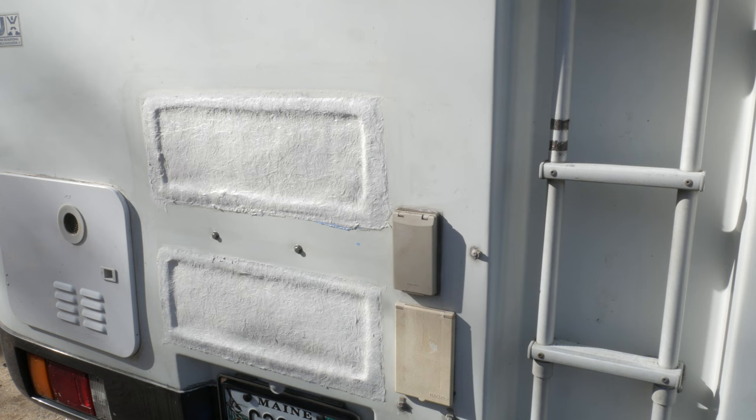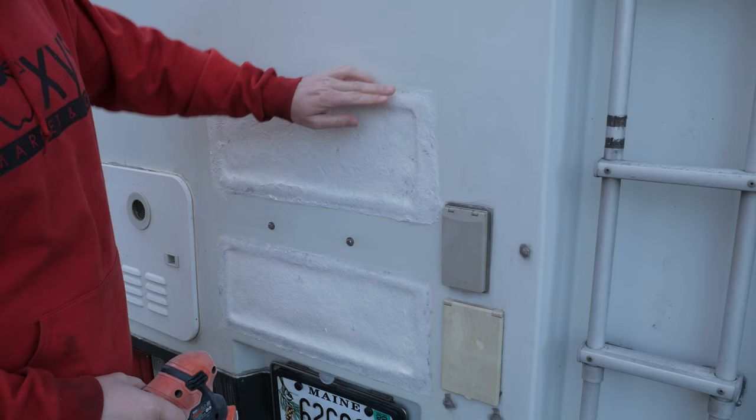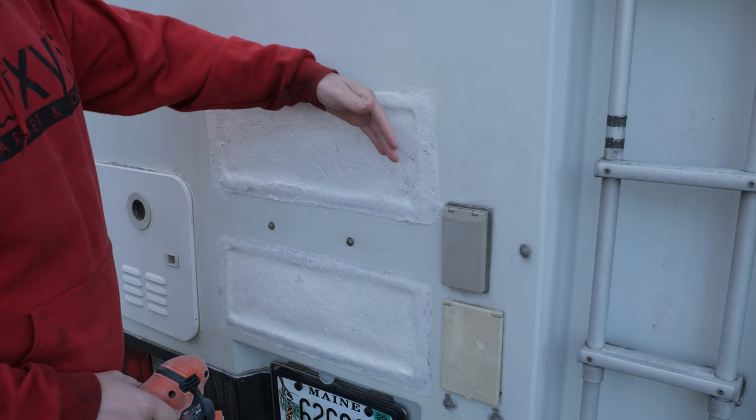Okay, right now it's hideous. It's gonna take a lot more work. Sanding. Painting. All right, now I have some 80 grit sandpaper. Gonna try to level all this out. And then add a few more layers of fiberglass, sand that down, then some filler, sand that again. So let's just try to make it look better.